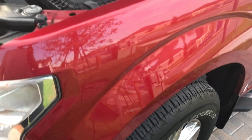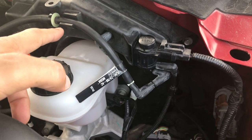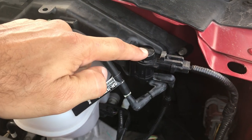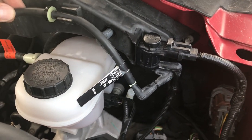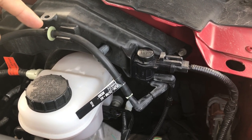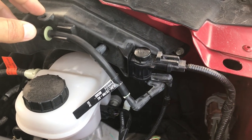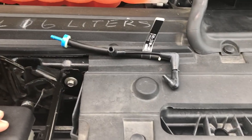What the IWE check valve does is disengage and engage the front hub on a four-wheel drive truck — it's a vacuum-based system. This is the old valve, and I can see it's the old model, not the revised one, because the actual valve is white and it's attached to the solenoid. This is what we're going to replace. It's really simple — you don't need any tools. One thing I found out: you can replace just the valve, but it's almost the price of the whole assembly, so I just bought the whole new assembly.